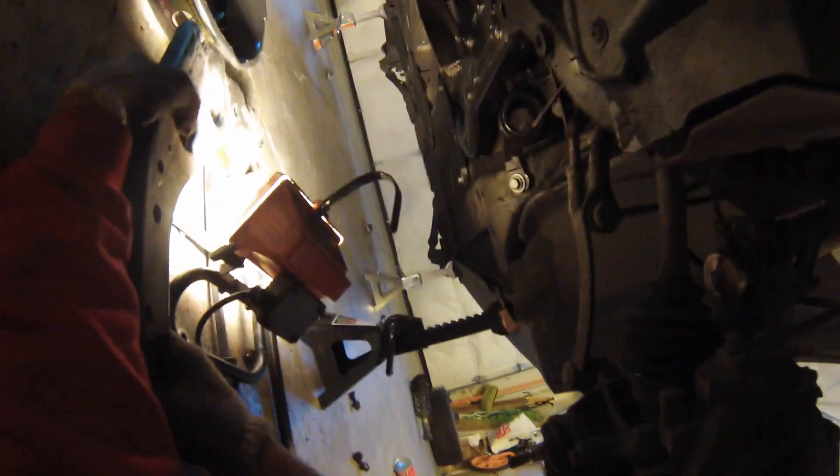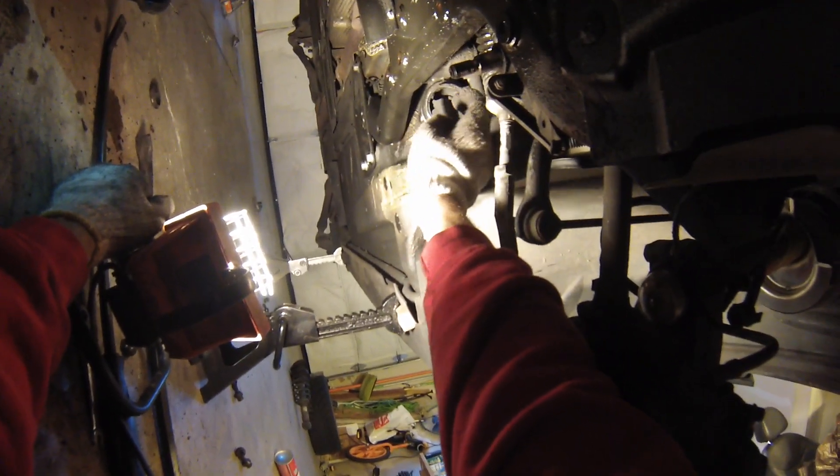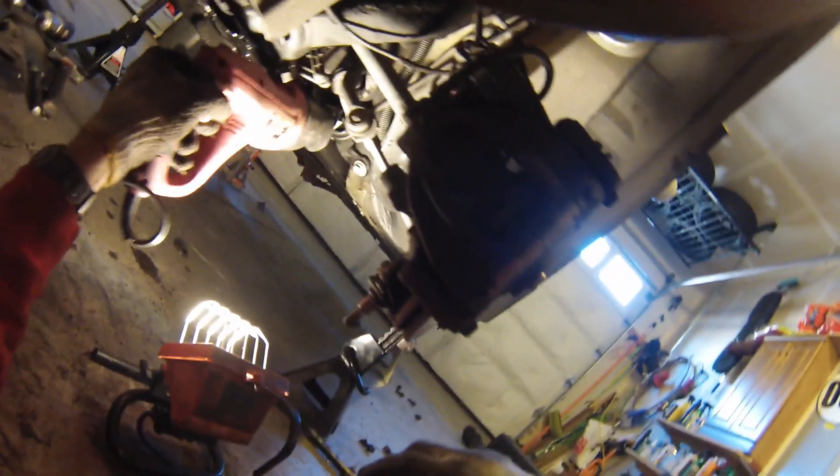I went and had pulled these control arms out. I don't have a hot enough torch to get these things out by heat, so I just use a reciprocating saw and cut them out with just a nice straight line along the bottom. I just find a nice angle that I can get a straight line cut in there and just have at it.